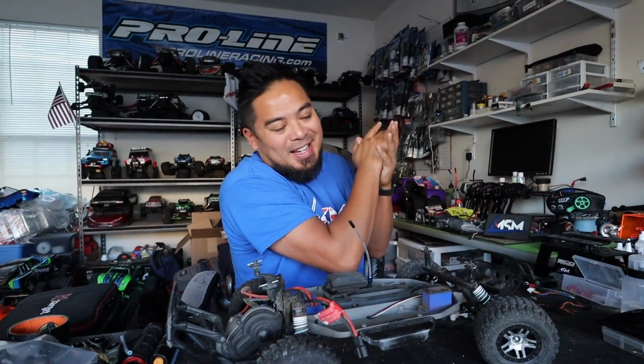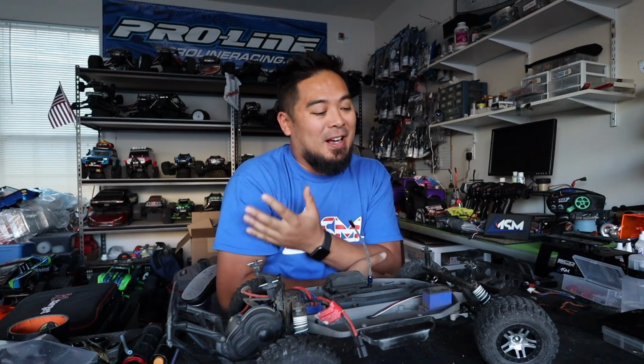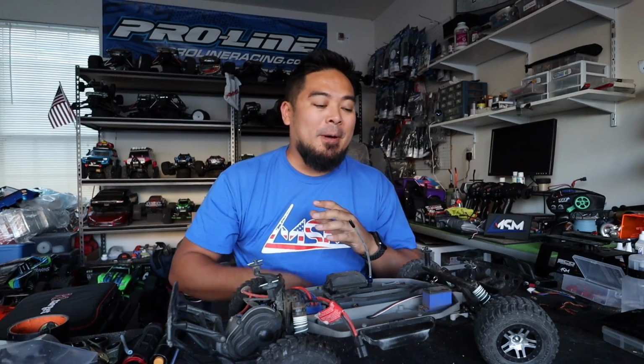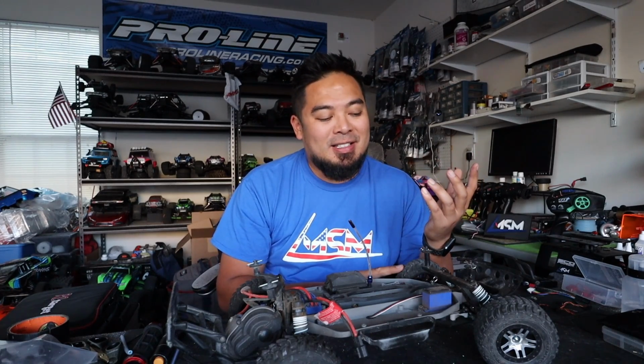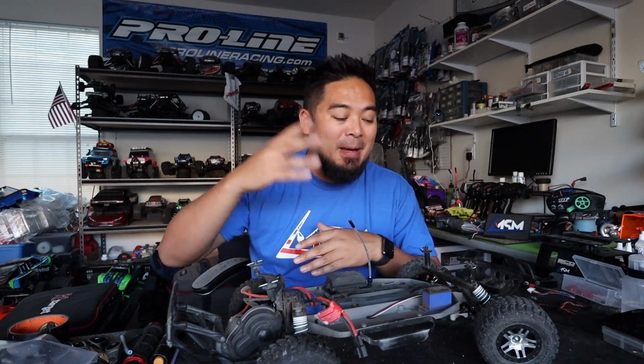All right, so the things I don't like, these are the things that I really worry about whenever I drive a Slash. On my car, I don't really have this problem too bad, but 2 of the things are on one part of the car, and I can't stand the shocks. I'm gonna say 2 things about the shocks that I really don't like. These shock caps pop off really easy. That's actually what happened to my son's car that was all broken down. His shock cap completely popped off.